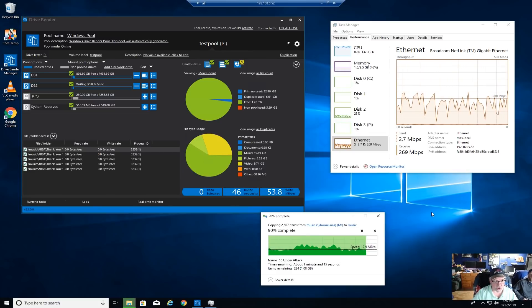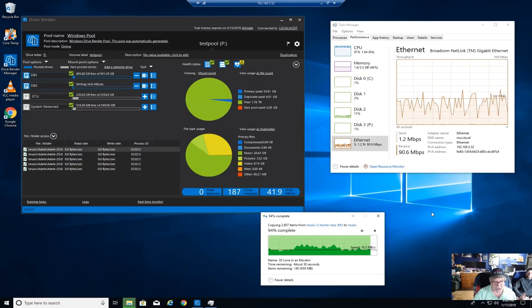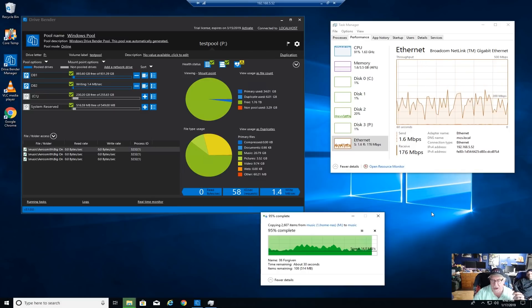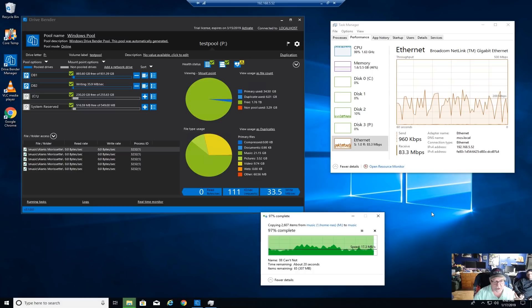As we come into the home stretch — it's not too bad. Remember we're doing this on the cheap and using an external USB drive, so you can't expect drive copy speeds as if you had directly attached drives. If I had these connected by SATA I would probably get better speeds. When copying larger video files I'm getting about 50 megabytes per second as opposed to the normal 100 megabytes. When I run CrystalDiskMark the read/write speeds on the drives are 100 megabytes per second, so I'm not sure if it's the overhead of going through a USB controller that lowers the write speeds. If any of you know, please leave your comments down in the comment section.